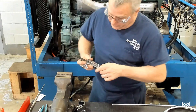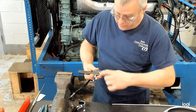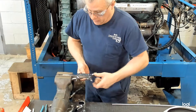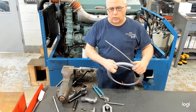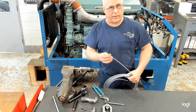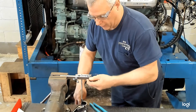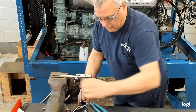The tool we're going to use is a split yoke flaring tool. You can see there are two sides to it — one side is flat with nothing on it, the other side has the sizes and also has a taper to match the 45 degree flare we're going to put on. This thing is designed to be clamped firmly in the vise. The line we're going to double flare is quarter inch, so we have it cut nice and square and deburred. Don't forget to put the line nut on with the taper facing toward where the flare is going to be, so the hex part of the nut will be away.